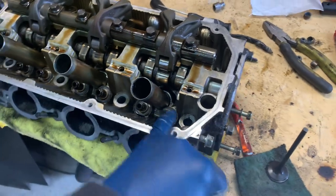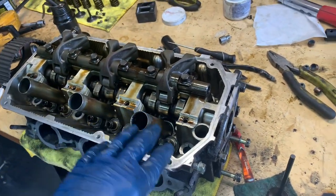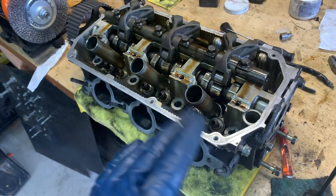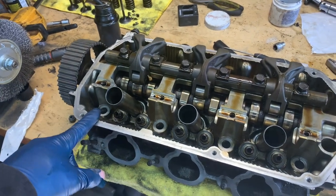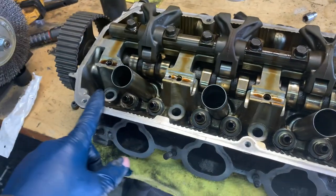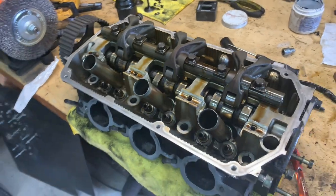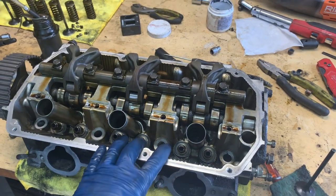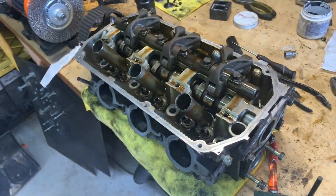It's the labor to get in here that is a killer. In order to get in here you have to disassemble the valve train, pull a valve out, or if you can do it in the car, you've got to figure out how to keep the valve from coming up when you take the spring off. It is a huge task. If your car is burning oil, the solution is probably your valve stem seals, and this is not going to be a quick fix. This isn't going to be a thicker oil or Lucas stop leak situation. You have to go in and fix these, or be okay with burning oil, which might affect your cats and definitely affects the smell. You want to be really careful you don't run it out of oil — that's how I blew up my gen two. I ended up blowing it up and rebuilding it.